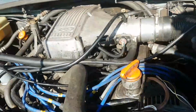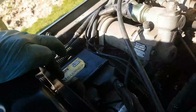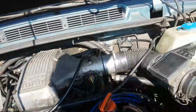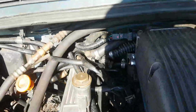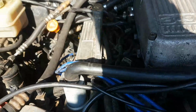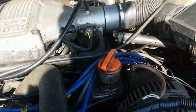And we went through all this phase of not understanding what the emulators were doing, because I haven't got the diagnostic cable for plugging into this OMVL millennium brain. That was a Freudian slip, wasn't it? So I ended up taking the plenum off, removing the whole of the LPG emulator loop, and plugging the ECU directly into the injectors. Let's make this circuit as simple as we possibly can.